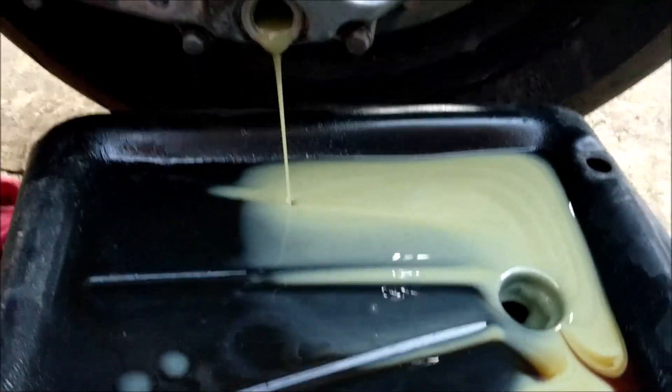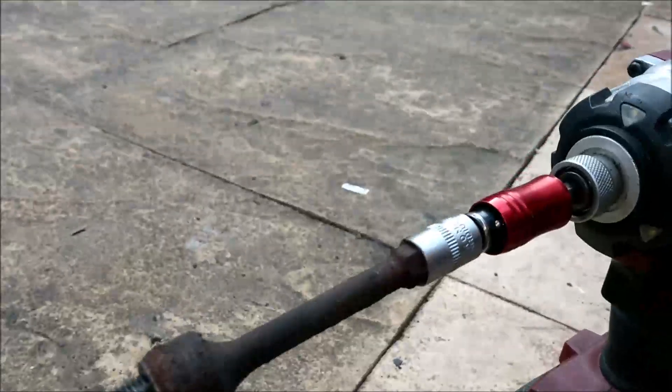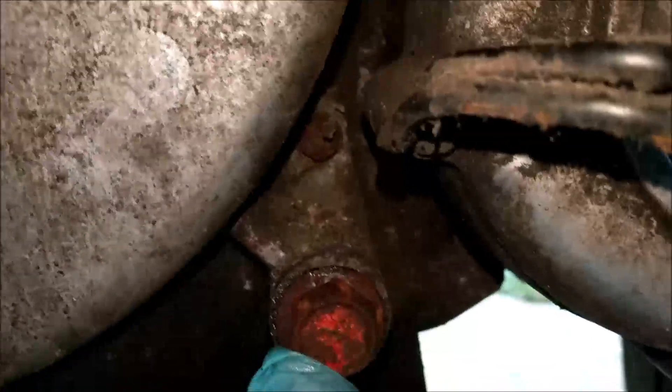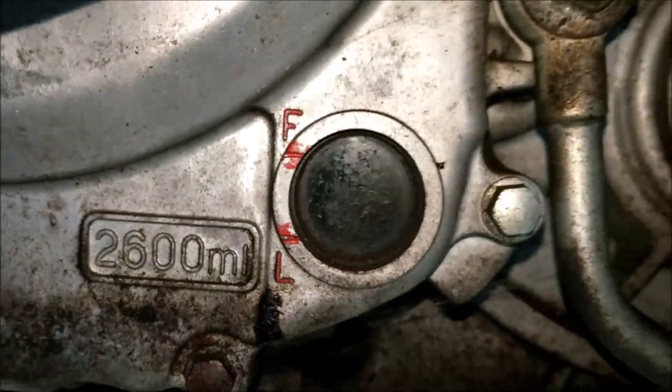So much goo is in the back of there. Anyway, that's the diff oil. We then have gearbox oil - it fills through there via the squirty tube that sticks out the top. There's the plug that came out of it, big long shaft, it's 10mm socket so it comes out to about here so you haven't got to reach in. There's the drain plug - I have drained it out already into this receptacle. And the engine oil filler cap - that plug was all done yesterday. I've probably put a little bit too much in.